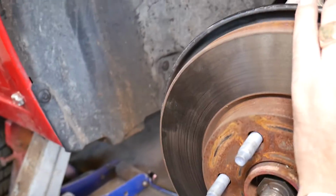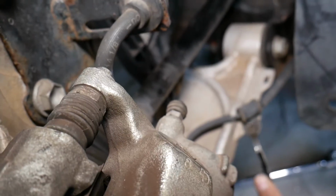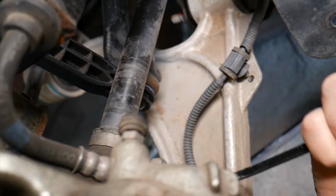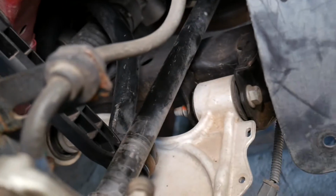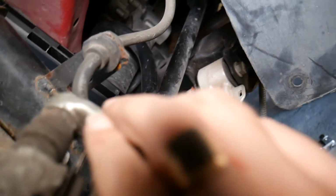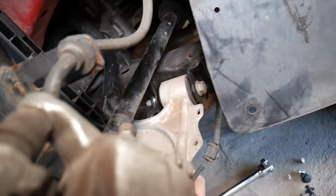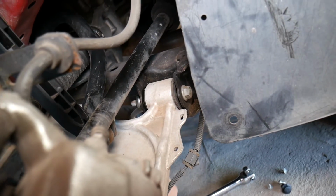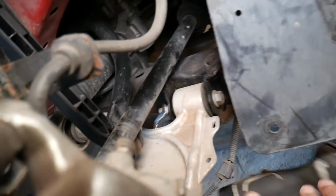They're still up there, but while we're still here, guys, we have one more right there, and we need to disconnect the ABS speed sensors. So disconnect that from the control arm. Okay, perfect. And what do we have now? Let me show you. Right there we have one more bolt, guys, with the same two there. We're going to hold, and I'm going to later start getting it loose on this side with 18 mm. This is the front mount of the control arm.